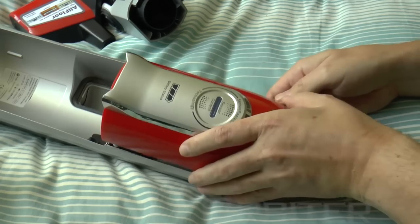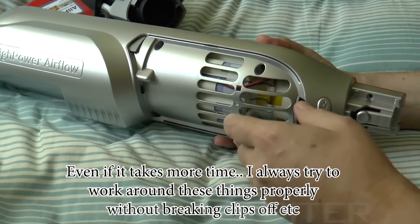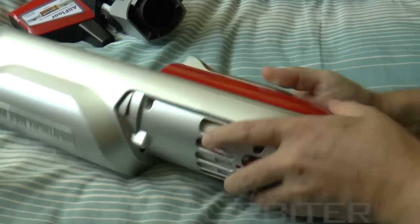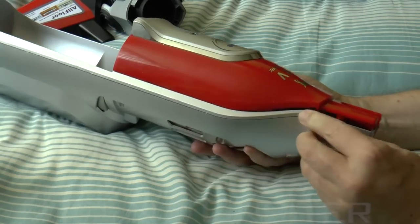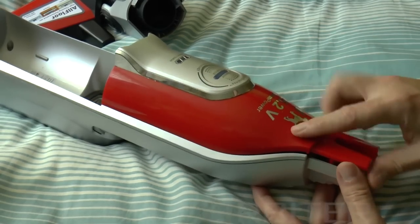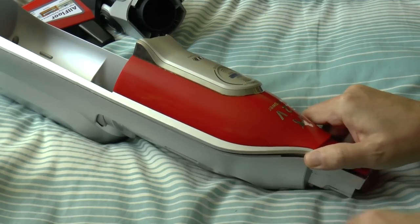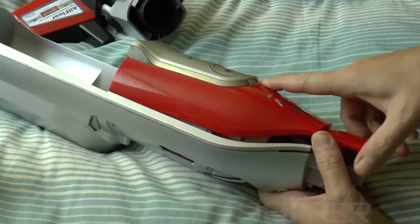For anyone who's got this problem, this is why I'm making this video. The front panel that fits on like that is difficult to say the least to get off. You don't have to undo the screws in the bottom to get this off. All you have to do is undo these six screws, and then you'll notice the red part will start to lift up but it won't come out. What's holding it in is this sort of secondary molding, which acts as a release for the clips. I ended up forcing it, and then I used a guitar pick just to lift that up.